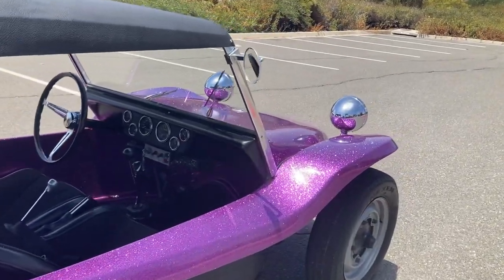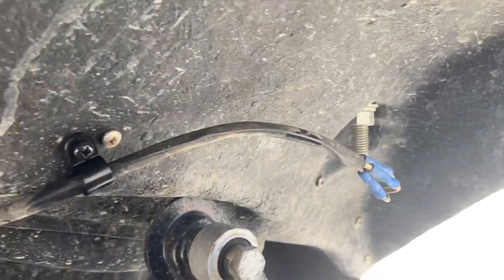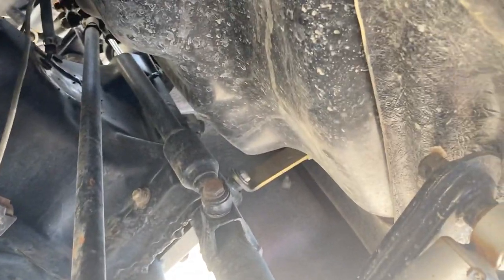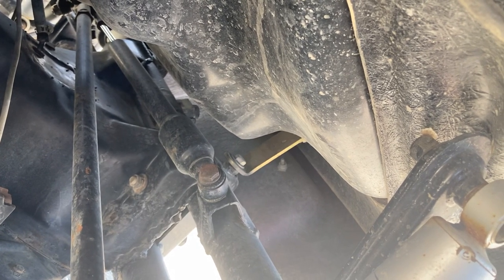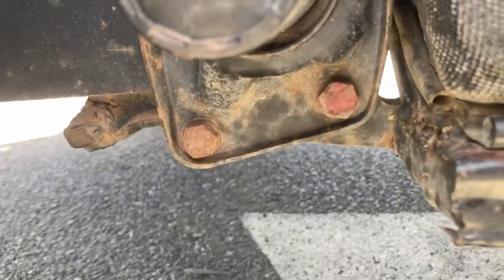Same mirror on the other side. Coming up front here — you've got your wiring up under here, plus the mount for the hood to the body, and an original piece mounting the body down to the front end beam. What I did was take the channel of the bug and bend it around some quarter-inch steel, then seal it up. That adds a little bit of strength and rigidity and makes it smooth here so you don't see the pan sticking out. This is also where it was shortened.